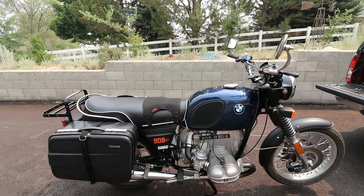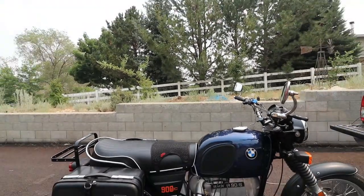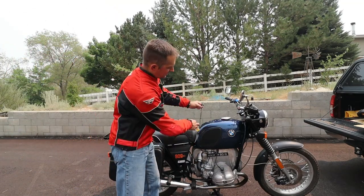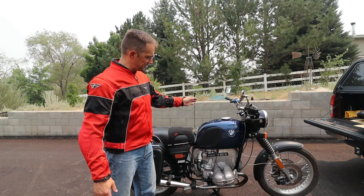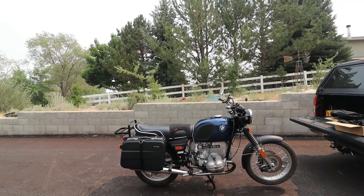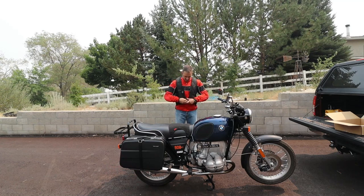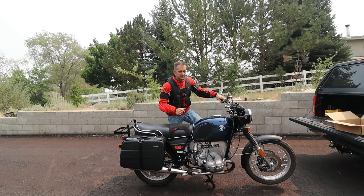Now I'm gonna move you back a little bit. And so they say that you're supposed to have it long enough that you can stand, but then it's supposed to be a rather taut, not loose flapping tether. So when you're standing on your foot pegs, like on an adventure bike, this is supposed to be rather taut. So let's try this. Move you back a little more. I still have the safety engaged, so we're not accidentally gonna blow up this thing. Click and click. I'm not riding in tennis shoes usually. I wear boots. Here we go.